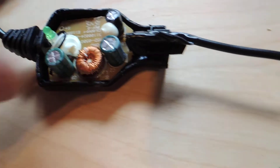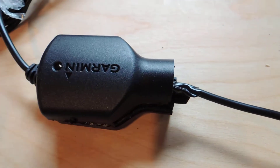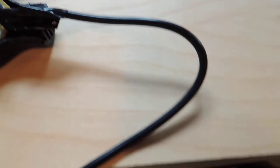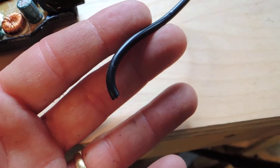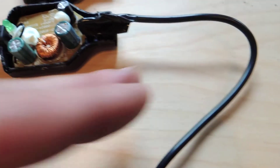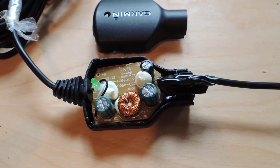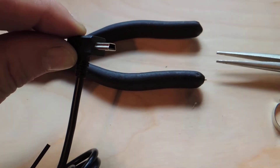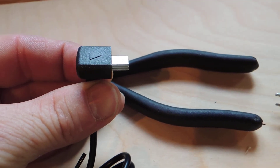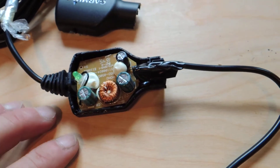That's what it looks like all done. I cleaned up these wires a little bit, put some tape around to protect it. This end just sticks out — all this gets hidden — and I want it neat enough where it's not going to come apart. Then I'll stick the other half of the case over it, wrap some tape around it to keep it together. At the other end of the cable I now have a positive and negative to hook up to switched power. This will prevent some of the error problems, though you could still have issues with the mini USB fitting loosely or vibrating — but this solves an awful lot of the problems.